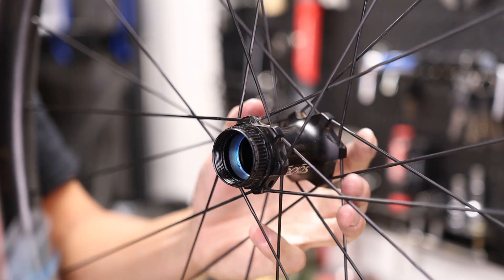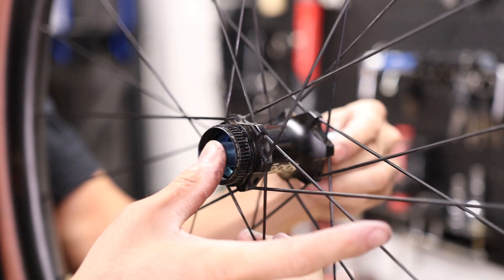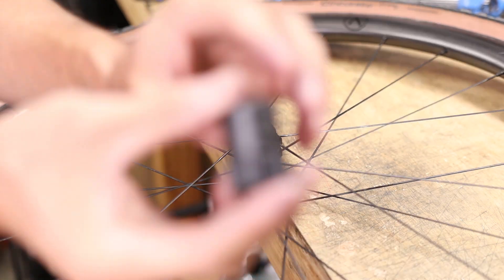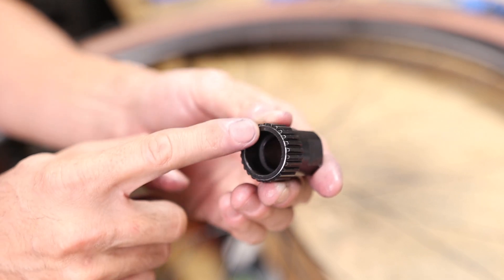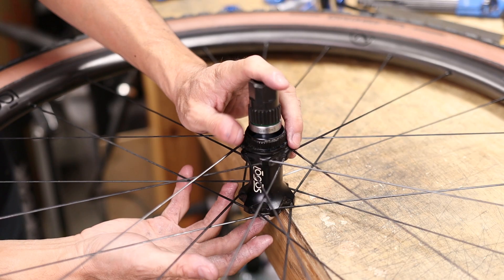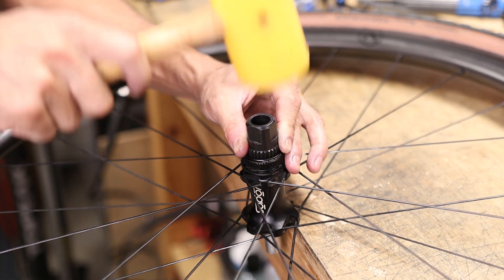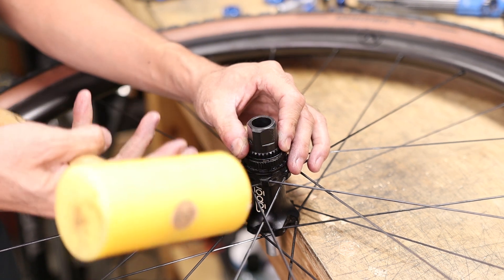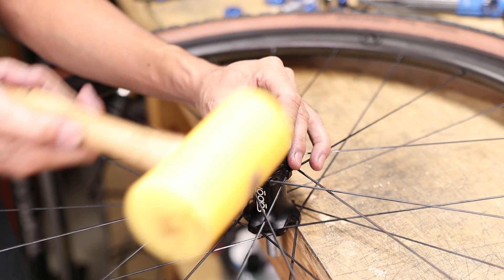Recall which side is the drive side — this is the non-drive side end. I already pressed in the drive side bearing, so I'll push the long side of the axle through for a nice perfect fit. On the opposing side, the bearing drift's inner diameter often won't be big enough to clear over the through axle, so a bearing drift won't help press this bearing all the way. It turns out the ratchet nut tool fits perfectly — its face mates up perfectly with the outer face of the bearing, which is exactly how you want to press in a bearing. Support the hub on the edge of a workbench so the axle can pass through, then tap it in. You'll feel a substantial jump in resistance when the bearing hits the inner flange of the hub shell — that's how you know it's fully set.